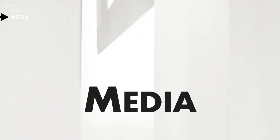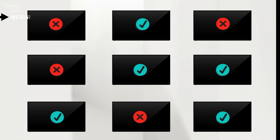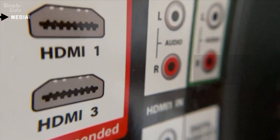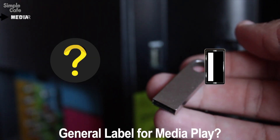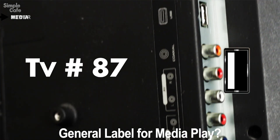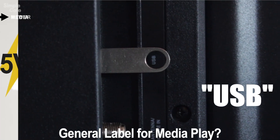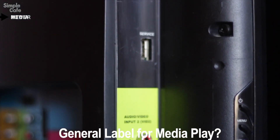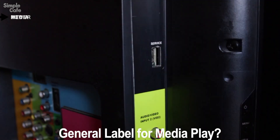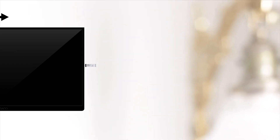Okay, finally — what about playing our media through USB ports? To be honest, I have encountered more TVs that will read and play my thumb drive content, which is nice. But how are we supposed to know that a particular USB port is going to be able to play our content? I've looked behind many a TV to confirm what a USB reader will be labeled as, but there doesn't seem to be a solid agreement. Even the ones labeled USB may still only be there to feed 5 volts. What I can tell you for sure is that if it says something like 'service,' it's not going to read your content. Honestly, at the end of the day, the only way to know for sure is to just plug it in and see what happens.